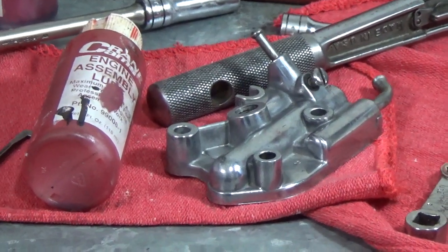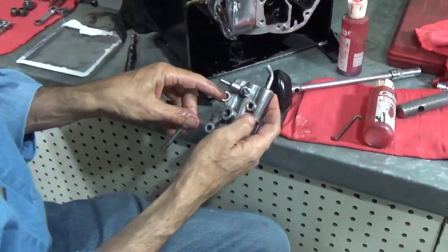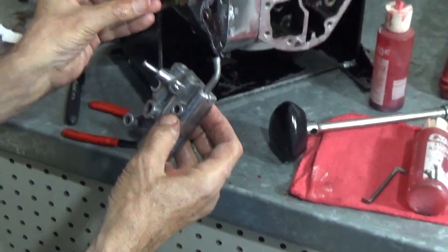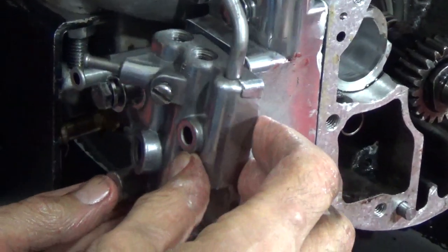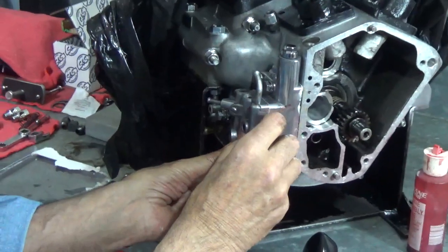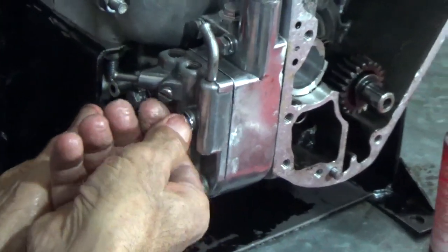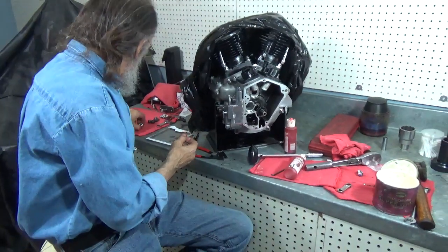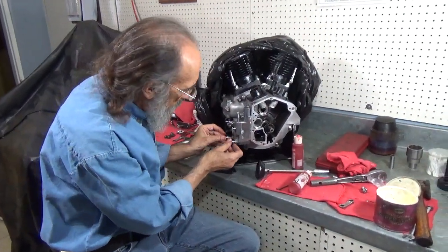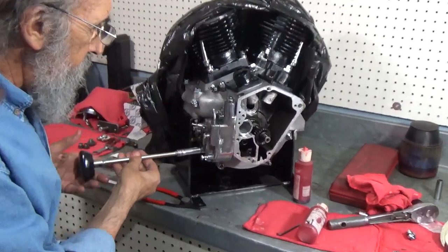Now that the gasket is on there, we want to put this bolt on. Now notice on the cover, this bolt hole of the 4 that hold this cover on, this one is slotted. So we'll just barely start that bolt. So we can slide the cover on just like that, and it'll be exactly where it needs to be. Once it's on, we can put the other bolts in. I start all these by hand, and then I can just put them right on with no effort.